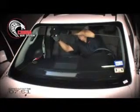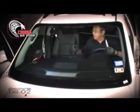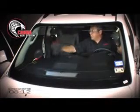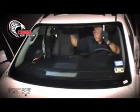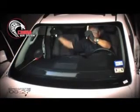Again, if the frit, the dot matrix, is on the interior of the glass, not in the glass in the lamination, I want to make sure that I keep the cup away from that area. Now, this particular vehicle, that stops. Now what I want to make sure is that I bypass that stop, just like so, and continue on my way. Keeping the installation stick in between it, just rocking and rolling.